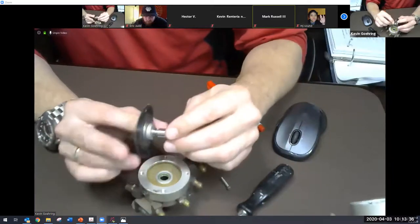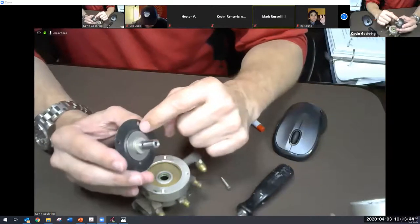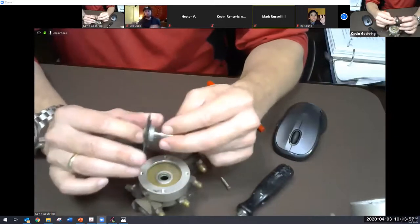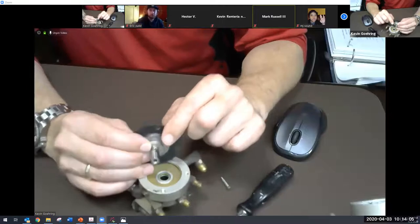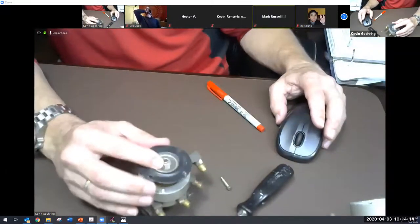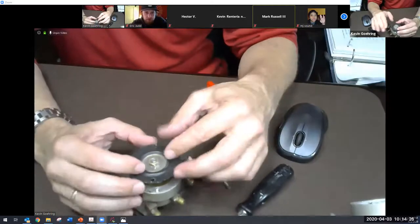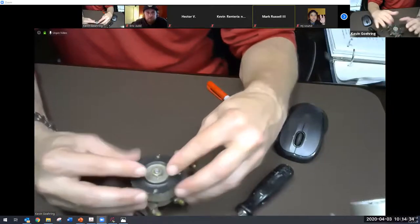The fuel enters into these little holes and goes down, but inside there's this little poppet. Remember surface area versus pressure — there's a lot of surface area so it doesn't take much pressure to lift it against the spring. Once pressure builds up enough on the very tiny little piston inside, the inner poppet is spring-loaded and it pops down, allowing fuel to go around it on the inside. When fuel flow diminishes, the inside poppet quickly closes, and then the little secret passage drains off, allowing the whole thing to settle back down and shut off completely.